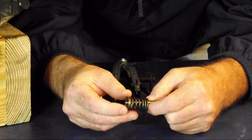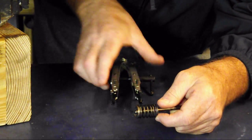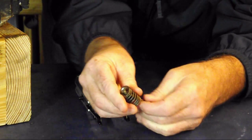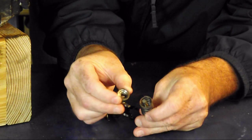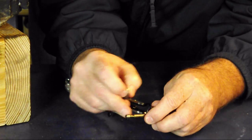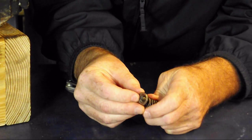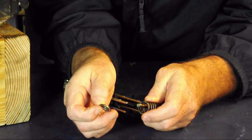These arms are adjustable to fit our retainer. Let me just show you what we're going to try to do here. We've got a retainer at the end of this spring, and we have to compress it. The reason for that is there's a keyway in this retainer — see how that is? In the center, our valve has a recess right here. And when we compress this spring, it's going to allow us to move this to the left and then pop it off.